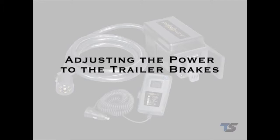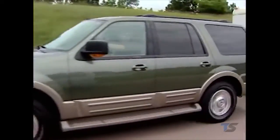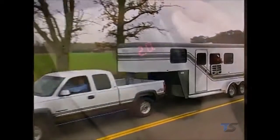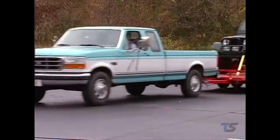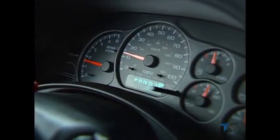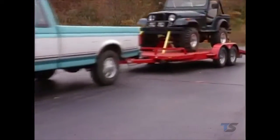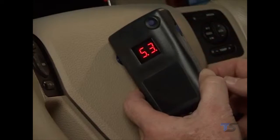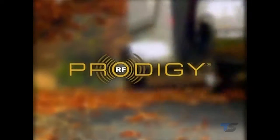Because every trailer is different, your brake control needs to learn the weight of the trailer and the condition of the trailer brakes. This is required to determine the optimum power necessary during an emergency stop without trailer wheel lockup. Once you've mounted the power module, plugged in the handheld unit, and paired the two, squeeze the manual override control and set the power to approximately 6.0. Then tow the trailer to a dry, level surface, take the vehicle up to 25 miles per hour, and reactivate the manual override. If the trailer wheels lock up, slightly reduce power and retest. If the wheels turn freely, increase power to a point just before wheel lockup and retest. For information to fine-tune your system for optimal performance, check your owner's guide for details.